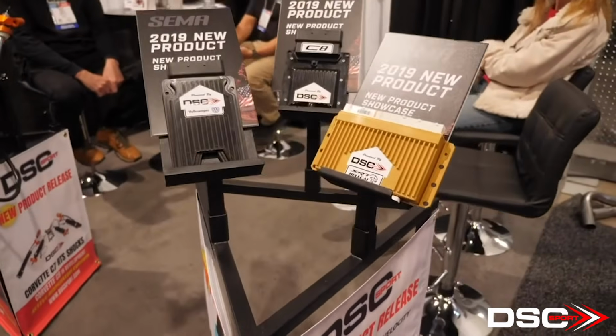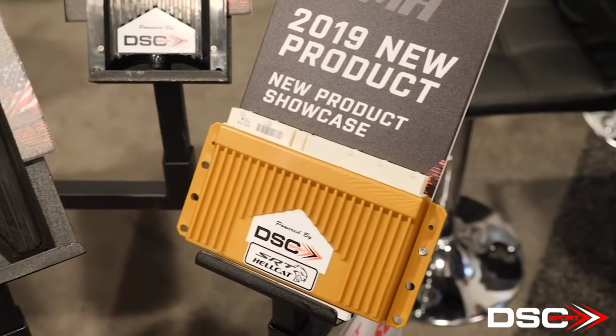Okay, yeah, we have a load-dependent system, just like an engine ECU, and our primary load is the G-force. So we're always looking for a G-force signature. That table is pre-written by us. In fact, every controller that we sell is already mapped very well. We spend a lot of time on it. Now, the other sensor that comes into play is brake line pressure, because in a braking event, the brake line pressure rises before the G-force. You're talking about a split second, but nonetheless, it's advanced. So we're using the brake line pressure to preempt the damping force before the G-force actually occurs. So that's one way to tune it.